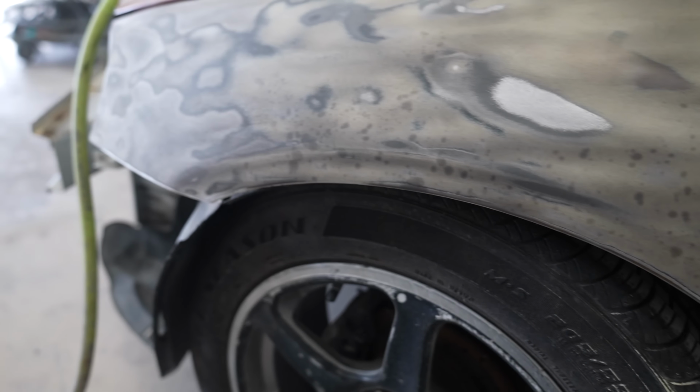All right, so after sanding off the guide coat on the top, you can see there's like six good little dents right across the top. There's a high spot over here. There's some low spots in the front. The second half and the bottom area seems pretty flat. We sprayed lacquer thinner on it and it showed really nothing super major. So I'll have to skim coat with filler across the top.